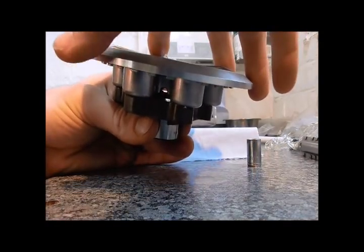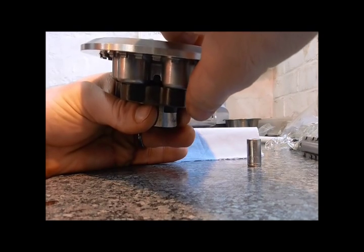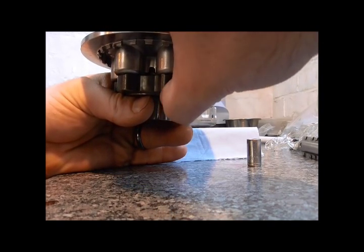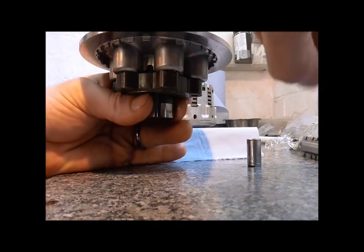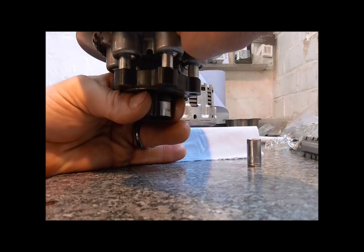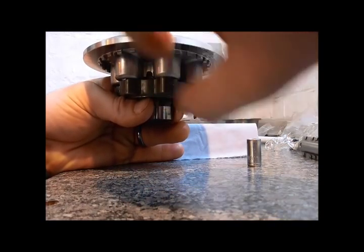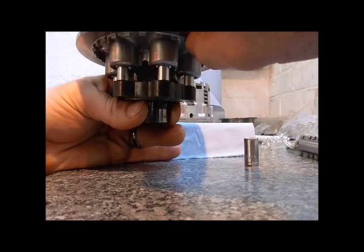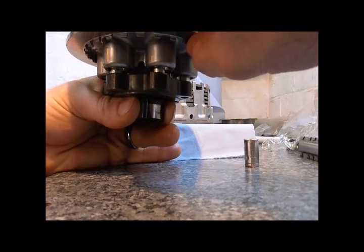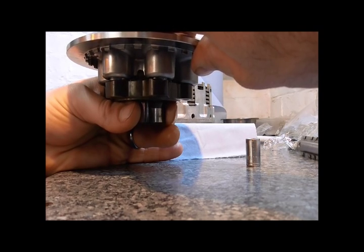That's under hard acceleration — it's just a way that Suzuki have thought up to provide more or less friction on the clutch under hard acceleration. What that does mean is when you're not accelerating, so during a gear change for instance, there's less pressure on this plate here. Remember what you're trying to do when you pull the clutch lever in is lift this plate up away on these springs to lessen the pressure on the friction plates. Because these springs at this point, when you're not accelerating, are under less pressure, you've got a much lighter lever than with a different type of clutch. Back torque limiting clutches are set up so that you have maximum pressure to your clutch except during hard deceleration or downshifting, when you end up with less pressure.